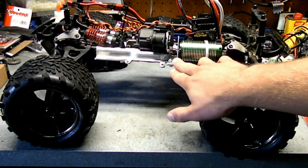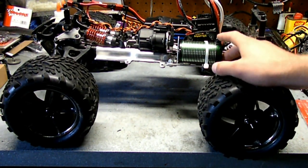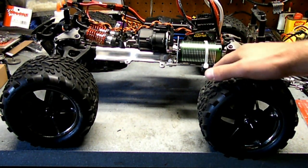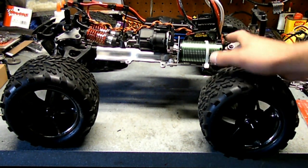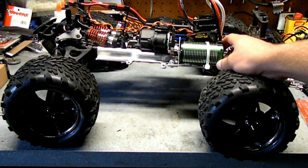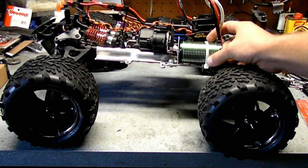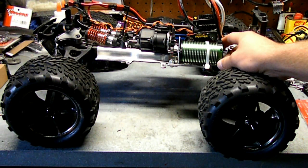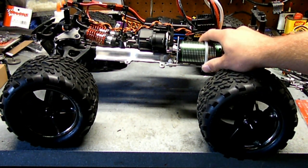The other thing I had done was change the motor mount a little bit. It's kind of a cheap fix for now — I wrapped a zip tie around the back of here and added another piece of plastic to support the back of the motor. Part of the reason I think the gear went so fast is that the motor would flex up and down under full load from braking and accelerating. So I decided to see if solidly mounting the back of the motor would help the spur gear last a little bit longer, but that remains to be seen.